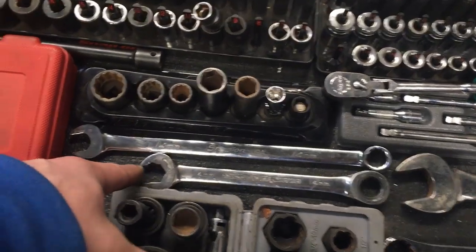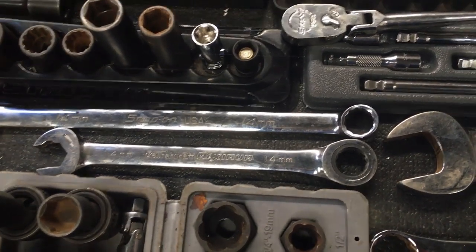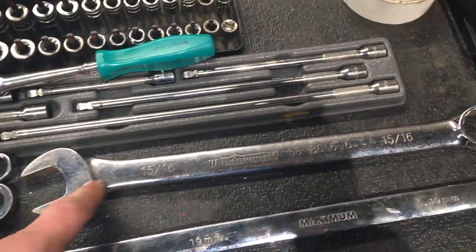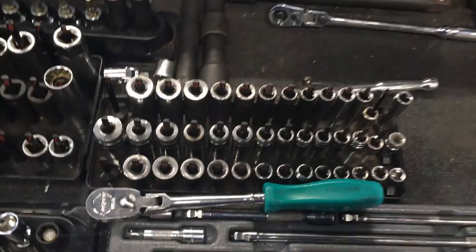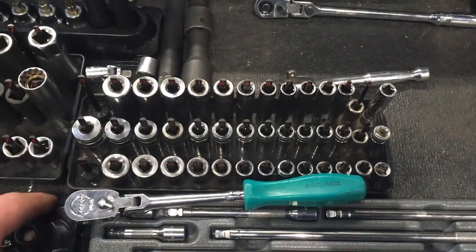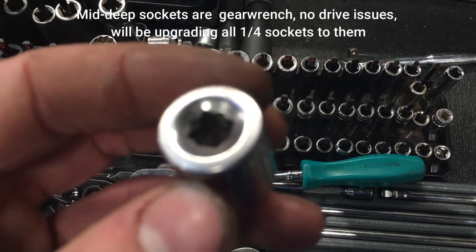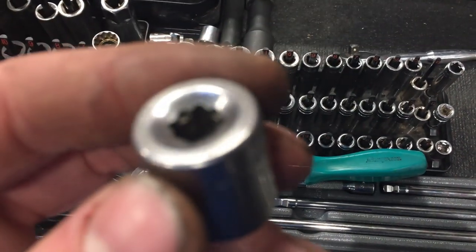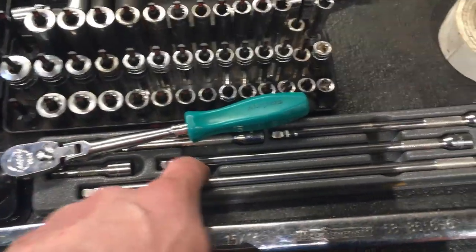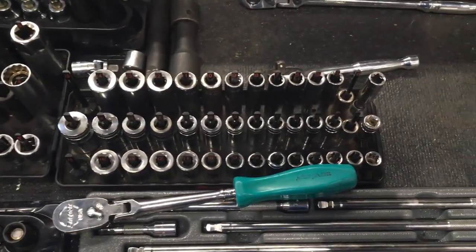I have a 24mm, 15, 16 — same size wrench for alignments as well. Quarter-inch sockets: shallow, mid-deep, and deep. The deeps and shallows are Maximum from Canadian Tire, which aren't great because of the drive style — they've got like an eight-point system and sometimes it's difficult to push the socket or extension onto it; they slip and slide around and are a little bit loose on Snap-on Wobble Pluses. But other than that they're alright — they don't round out or anything like that.